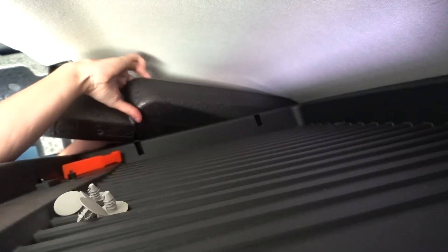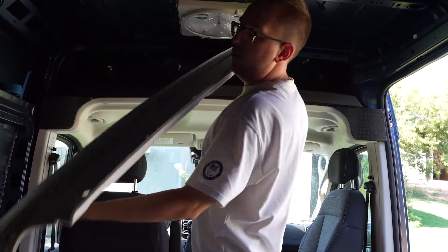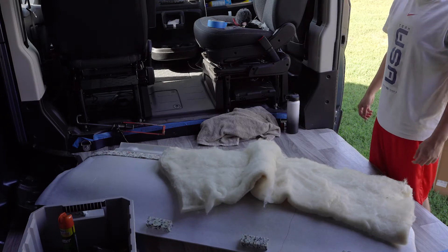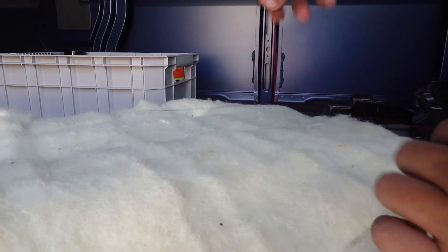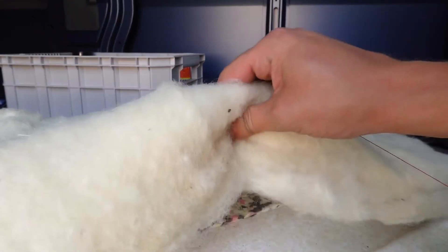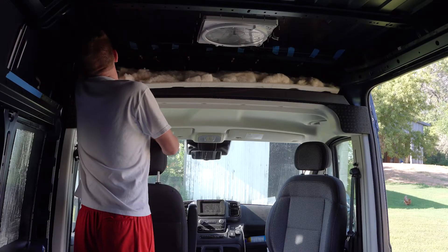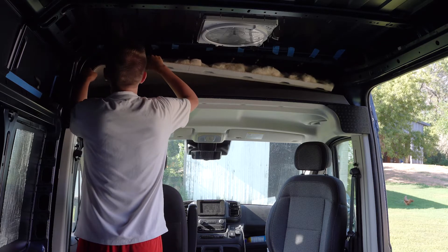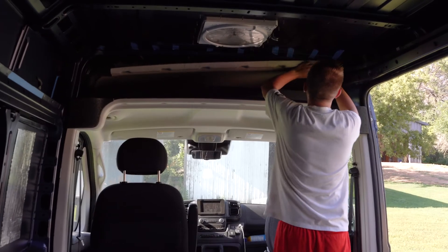This is not an easy process. Headliner out! Well, it will just lay on top. So I just tie this knot in the string — this is just going to keep gravity from moving it around and having it fall down. That's good. Okay, let's try to get this into position. Try to get like the two corner clips popped in there.